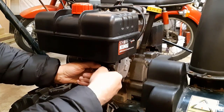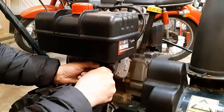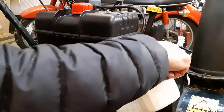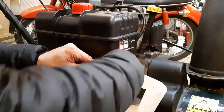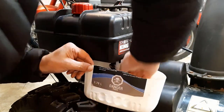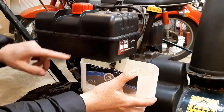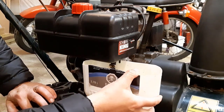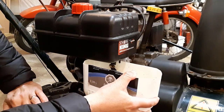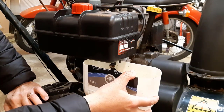I just got to take the hose off this connection — you could call it something like a petcock because it shuts the fuel off. I got a little bit of fuel on my fingers there. I'll just drain this fuel into this container right here. All the fuel will come out of the gas tank, the fuel tank, into this container, and I'll just reuse this gas in another motorized machine or put it back into a gas can.